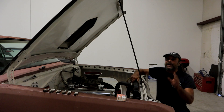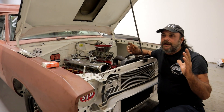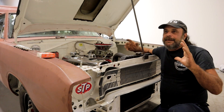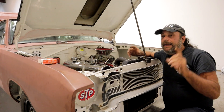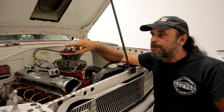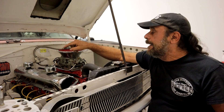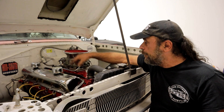That's one of the reasons why bracket racers — professional, hardcore bracket racers — always go with very big engines. They'll always go with a 540, 580, or 600 cubic inch engine, and people think it's to go fast. But bracket racers go with very large engines because large engines are much less susceptible to this sort of thing. The smaller the engine, the more finicky it becomes. And now — confirmed carburetor guy here — this is a perfect example of where port fuel injection would be far superior to a carbureted setup.